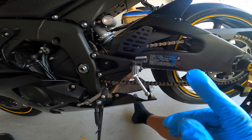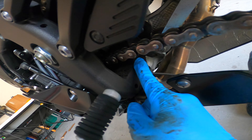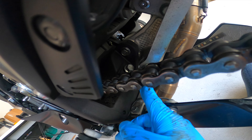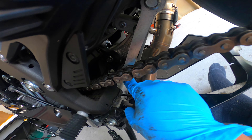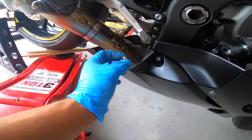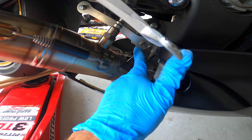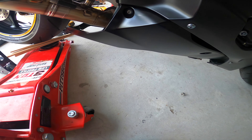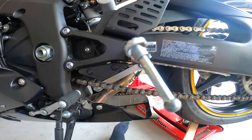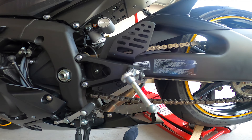First of all, this is not a tutorial, just so you guys know. We're gonna be taking off this little bracket first — this little bracket right here — so we can have access to this nut right here. There's nuts here, one there, one there. You gotta take these off first and then hit the bolt out. Word of advice: do it from the other side first, take the nuts off the bolt first.